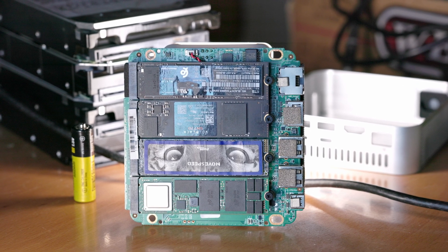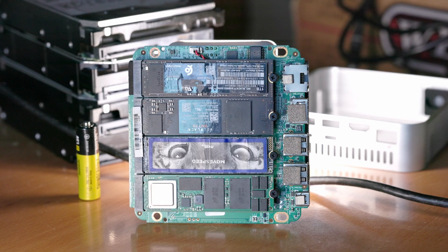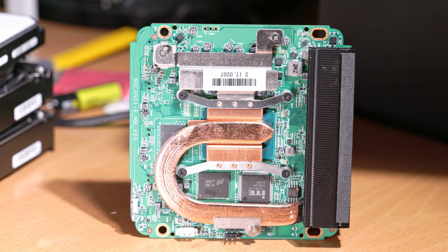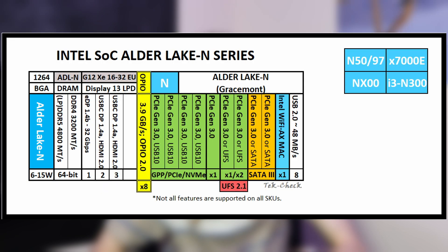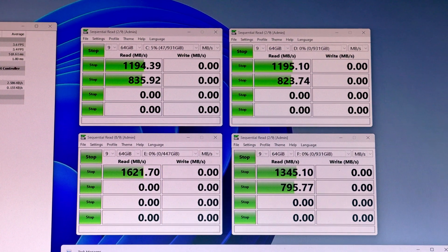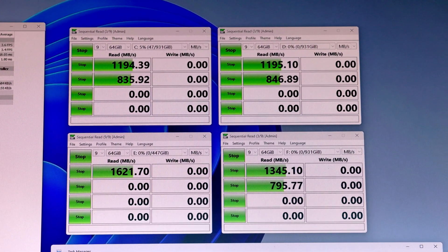Once the heat sink is removed, I can see all four M.2 SSDs. The first thing I was curious about is what speed are these drives connected at — and they're all connected to the CPU with a PCIe Gen 3 x2 connection, or roughly about 2 gigabytes per second maximum per drive. The N100 has a total of 9 PCIe lanes, so with two going to each of the four drives (8 lanes total), the last PCIe lane goes to the Realtek 2.5 gigabit NIC, using all lanes on the CPU. Performance tests maxing out all drives simultaneously showed about 6.5 gigabytes per second, which is more than enough I/O for almost any application a mini PC like this could see.